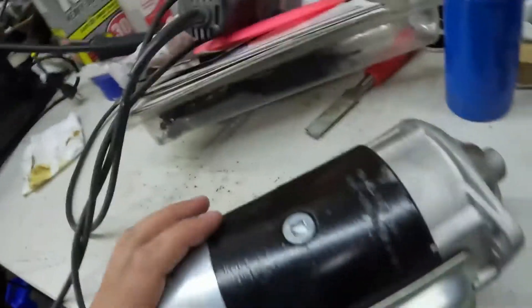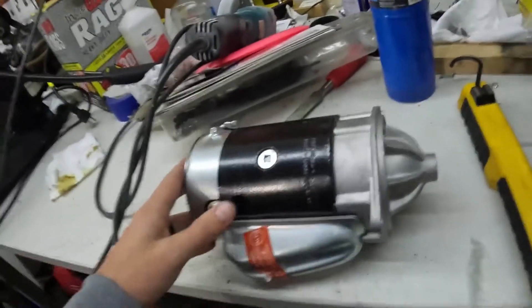I got the starter out and did a little test on it with a battery and jumper cables and it did not work at all, so I went out and bought a new one. Just to make sure I did everything right, I'm going to test this one as well. I'm going to throw it back in the Mustang — I'll show you how I get it in there. It was kind of a pain with the rack and pinion that's in there that didn't come with the Mustang. I'll show you guys how I did that, coming in from the passenger side.